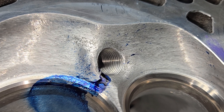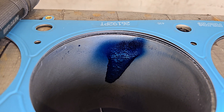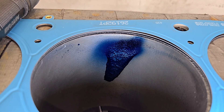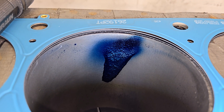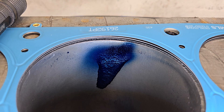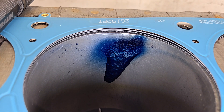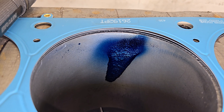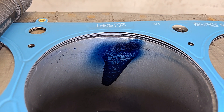Let's see what the bore looks like. The bore - we did this at 750. This was 750 lift; Charlie's going to be running a 750 lift cam. So it's flown quite a bit at that point, and at 750 it had zero swirl on the swirl meter. As you can see from the angle of that attack, it really has very little swirl at that point.